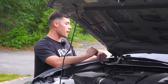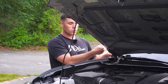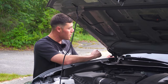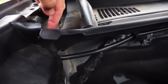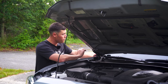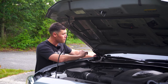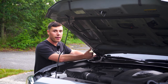Run the ditch light wires toward the outside, under your front fenders on both sides, behind the bracket — which keeps them out of the way — then down through your weather stripping and across. This routing is much cleaner and free of getting cut or smashed by anything. I would strongly recommend doing it this way, not the previous way I had it.